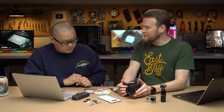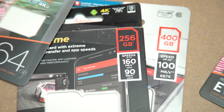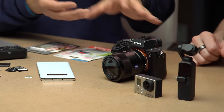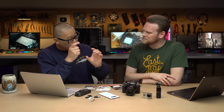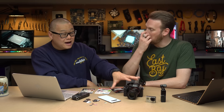What about photography? So for photography it's different. You generally want to buy a memory card where they brag about it. If they brag about their write speed — this memory card says 90 megabytes a second, this Lexar professional card says 1000x — they're basically saying we can hit a minimum write speed, and in a DSLR that makes a difference. So V30 doesn't necessarily mean it's going to write the fastest. You can get memory cards that will write at 90 megabytes a second and they won't be V30 or V90 rated.